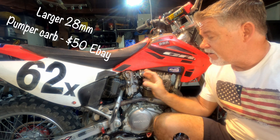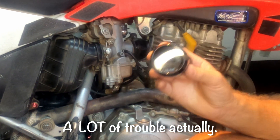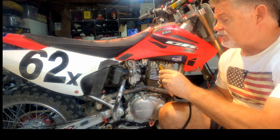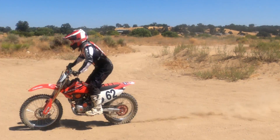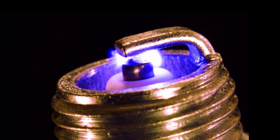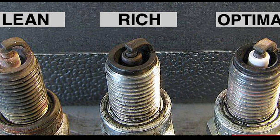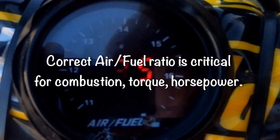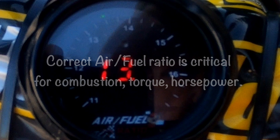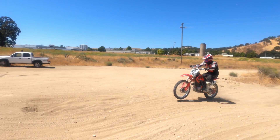So especially with this carburetor, I've had a little bit of trouble tuning this thing. I thought, what better way to tune it than actually have an air fuel gauge that I can actually see, and put on an O2 sensor. Why would you want to put an air fuel gauge on your bike? It's going to allow you to do your jetting while you ride. The days are long gone when you can read your spark plug to see if the thing's running lean with today's modern fuels. Running too lean is going to overheat the engine with possible damage. Too rich is going to gum things up with carbon and soot and lack of power. If we get it just right, we get the most power out of the engine while keeping it relatively cool.